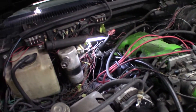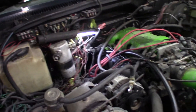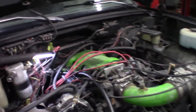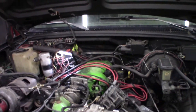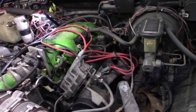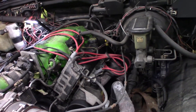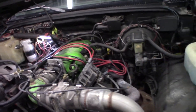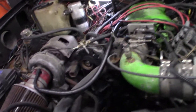One other thing I had to do was sort out the transmission. I originally started with an adapter plate but was having issues getting the proper converter to work with the V8 700R4. I ended up just grabbing a 3.4 Camaro 700R4 and basically bolting it in. That's been good since — the converter setup is right where it needs to be for a 4,700 pound truck with a turbo V6.